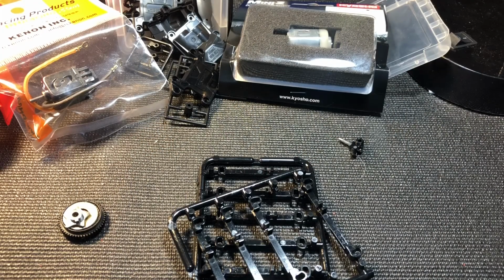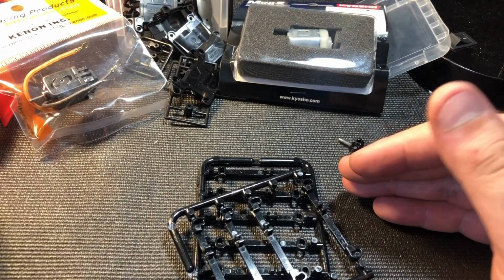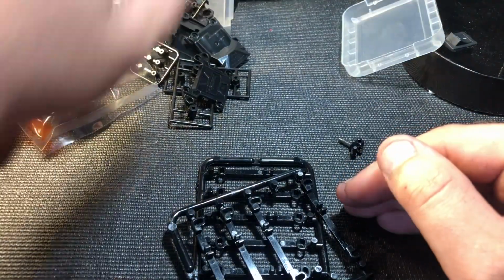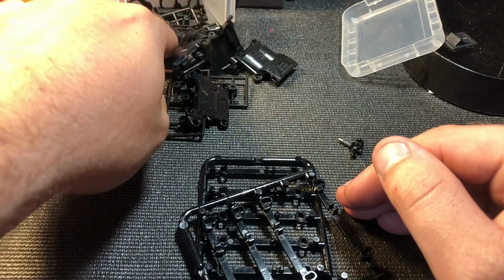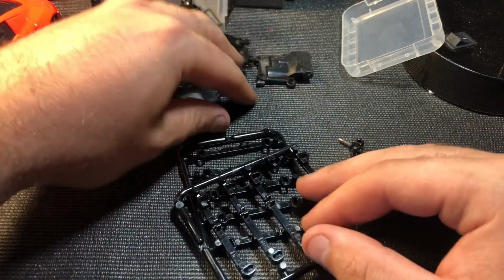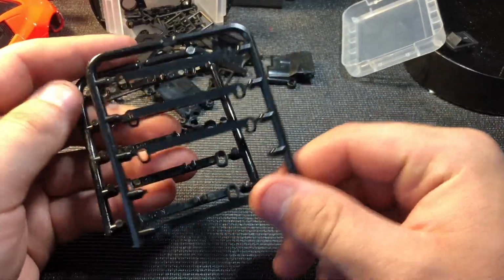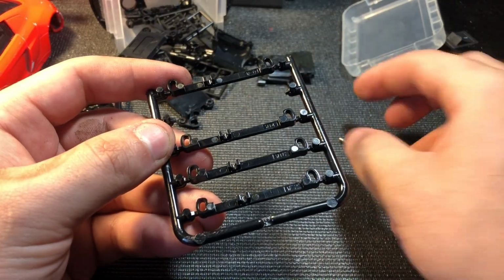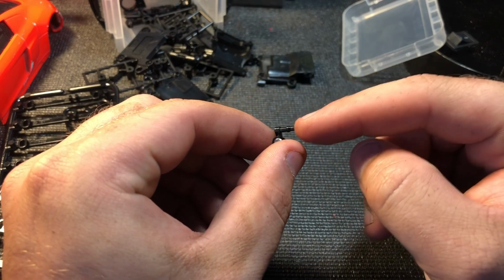One thing that's not necessarily a necessity to go racing, but it is really nice to have, is spare parts. Here's another spare diff. There is another spare MPN70, stock Kyosho, a bunch of random top plates, more screw stuff, different motor setups. Always great to have. And you've got Ackerman plates. These are the adjustable ones, so you'll have 0, 2 is in the car now, 4, 6, 2, -2, and knuckles. These things do break right here.